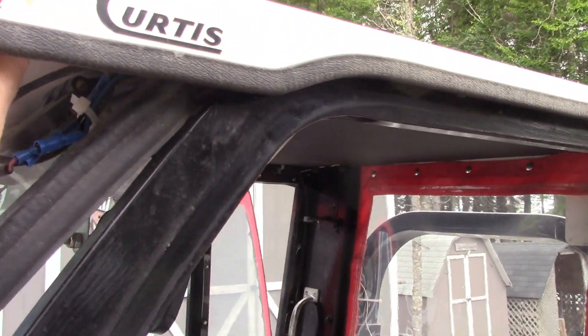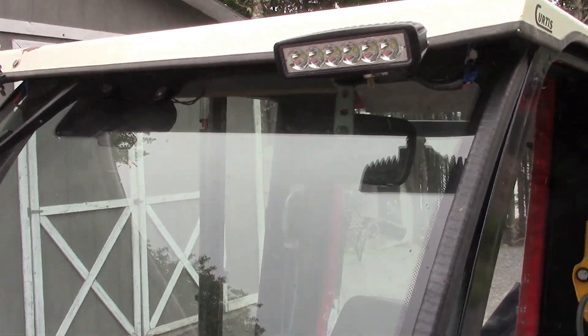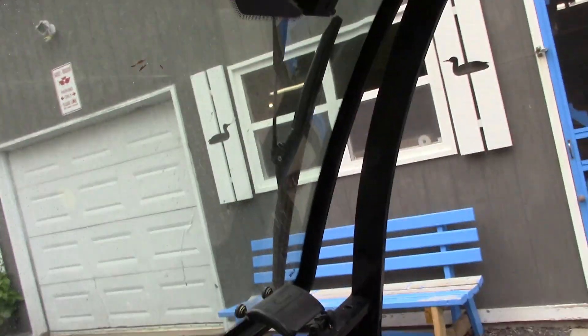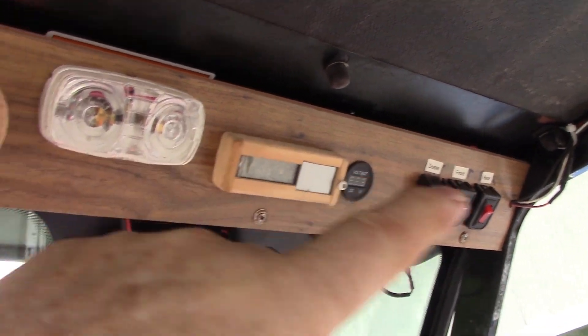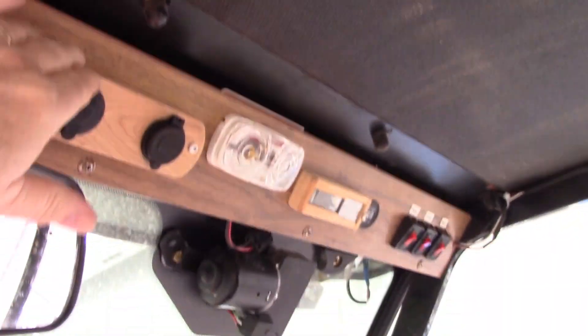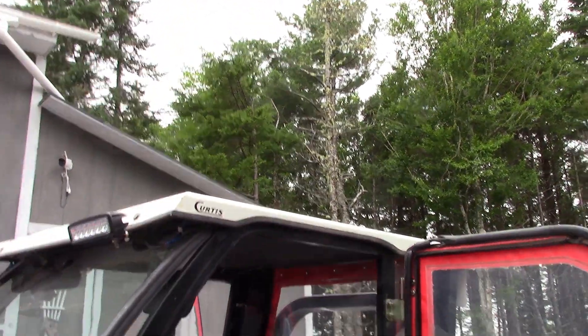The top of it is a pretty good gauge steel. This isn't powder coated — it's a good enamel finish on the cab. The cab is a good size. Although I have it covered up with this little headboard that I put in, there is a piece of steel that goes across the top here that curves down and picks up the top of the windshield — that's where the hinges from the windshield are mounted. It's a cross member similar to what's below the windshield. All I did was face it up a little — put a headboard on it and a few attachments. The headliner is also lined with foam, and I find that makes a big difference. Without it, because there's no real bracing through the center, the headliner tends to wobble and makes a noise. But with that foam on there, it cuts out that noise.